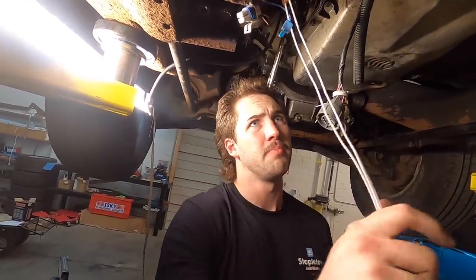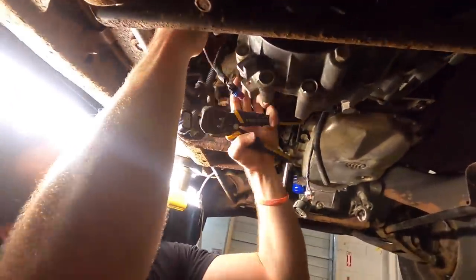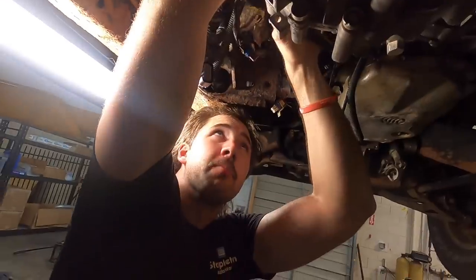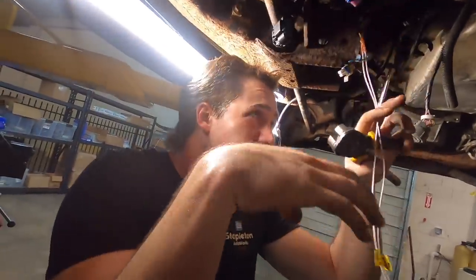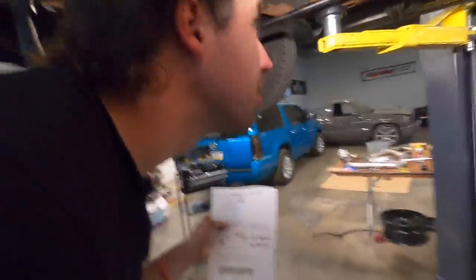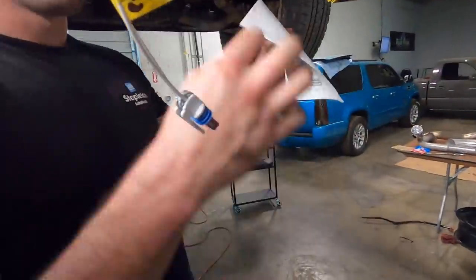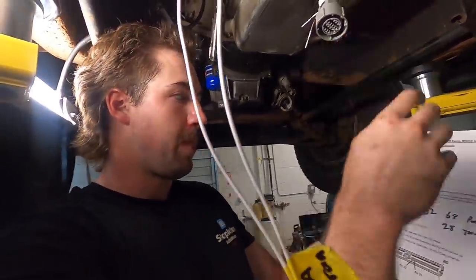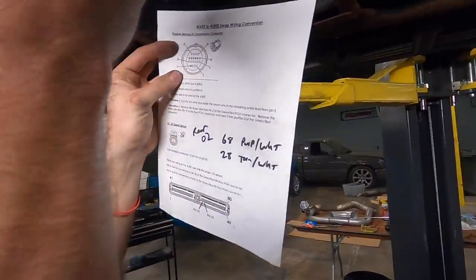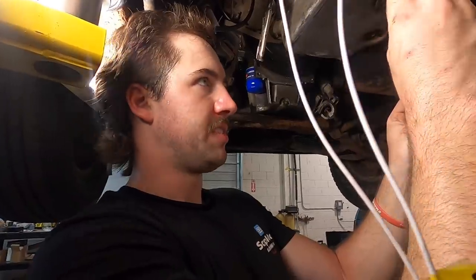The VSS wire should be long enough - there's already a sensor in the transfer case so we'll plug in right up there. We'll heat shrink these and add loom to that first. Now we're pretty much done with the ECU side. Going back to the transmission connector: remove pin S white and brown, insert brown wire into position S - that one on the very end that it came out of before, on the side with the dead spider nest.